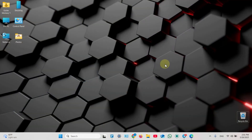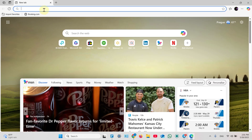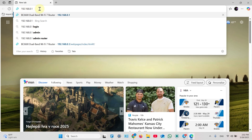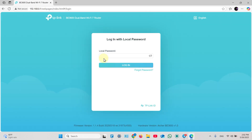Unfortunately, there is no option to create a backup from the mobile application. However, you can easily do it from the web interface of your router from your computer. Open any web browser, and in the address bar type in the router's IP address — by default it looks like this, if you haven't changed it. Hit Enter and enter your admin password. You should know this password because you created it yourself during router setup.